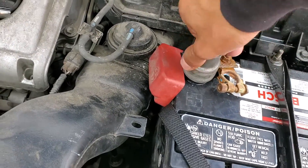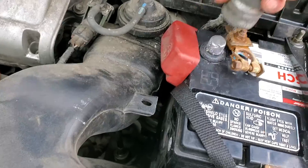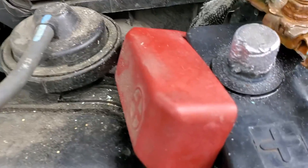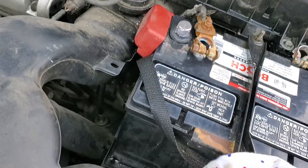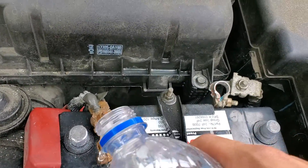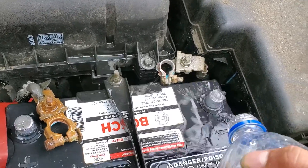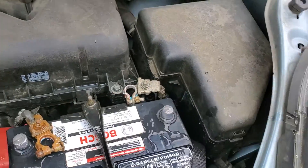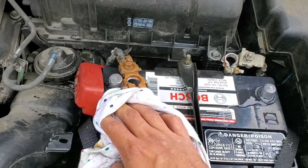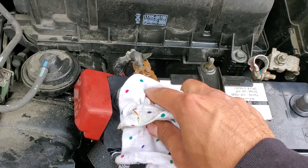You don't have to really scrub it that much — just a few turns should do it and it comes out really clean. As you guys can see, the positive end is a bit corroded from the acid. Make sure you wash off all that lead you just took off with the battery post cleaner, because that stuff is really bad. Wash it off with water — it won't rust since it's made out of lead and not iron or aluminum.